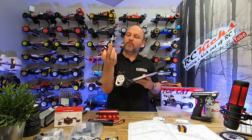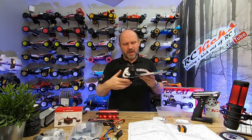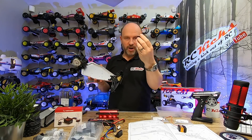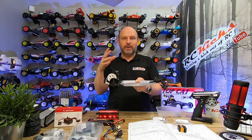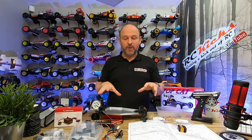I really don't want to buy a dedicated battery just for this car — I use a lot of these on my Tamiyas. I do have a 3S battery which is square and may fit, so I'm going to try that. I also have a half-height servo that I can use as an option, but if I don't need it I'll save it. I've sorted out my electronics — I'm going with a HobbyWing 1060 and a FlySky transmitter/receiver. I'll put all the descriptions and links in the comments below. I'm going with a 19-turn Team Orion vintage brushed motor. I'll stick with the stock pinion first and see how it behaves.